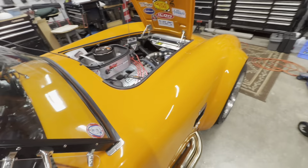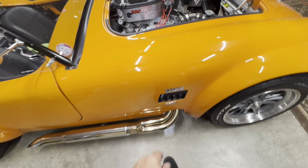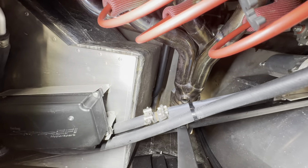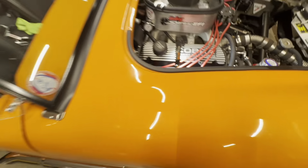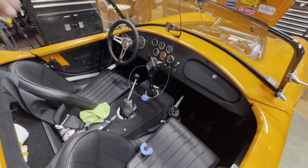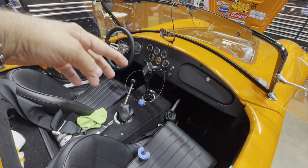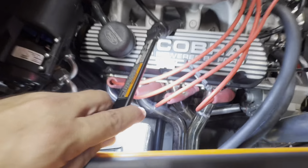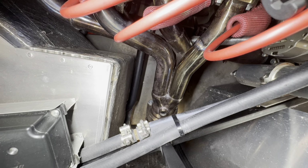So the tech told me that I should have a leak somewhere through here, an air leak, because the oxygen sensor is over on this side. So he's saying that it's operating like it's got a leak, because every once in a while the air ratio would go up to 35.6, which is pegging the oxygen sensor. So with the oxygen sensor reading that, at least when I step on the gas, he thinks that it was an air leak.